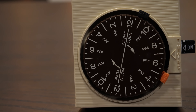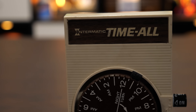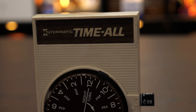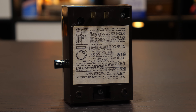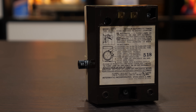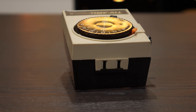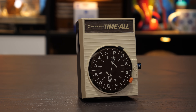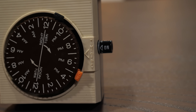Let's take a look at this consumer-grade timer switch. This Intermatic Time-All was a staple of American life, or at least some American lives, in the 1970s probably. I'm having a heck of a time tracking down specific dates for this model's introduction, but it's old enough that it doesn't have a polarized plug, which makes it borderline useless today. Sure enough, it's basically a weird-looking 24-hour clock that has a wheel instead of hands, and hanging around the edges of that wheel are these little movable tabs marked on and off.